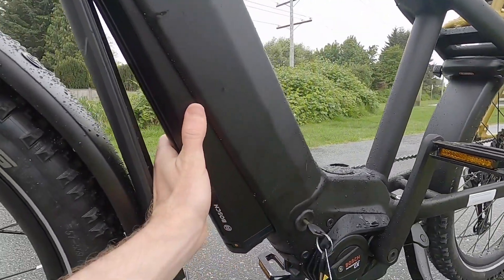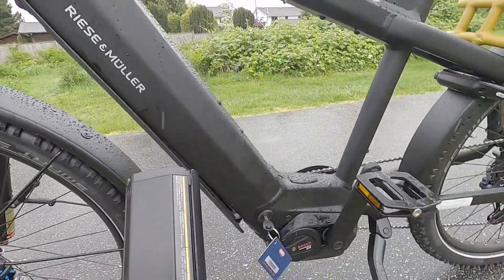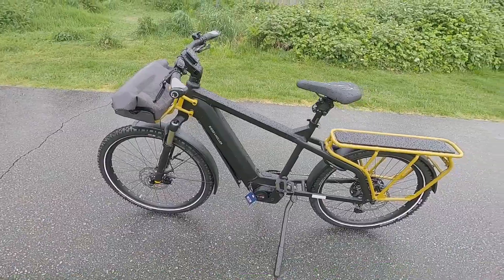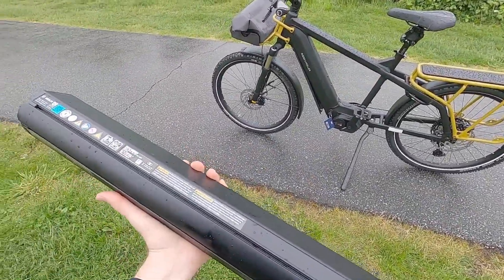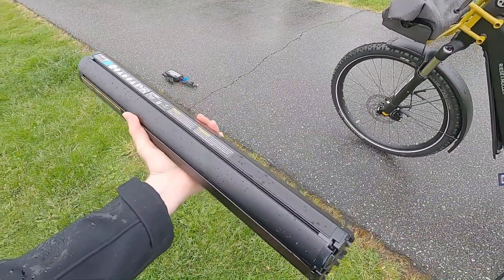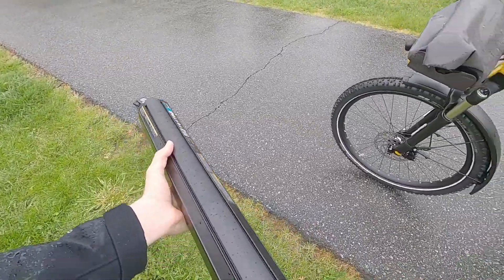This is like a nine-pound battery — pretty heavy, long, and big. You can take it off the bike, which is handy for charging or just making the bike lighter. The bike itself is about 70-plus pounds. You want to keep these batteries in a cool, dry location. Extreme heat is hard on them and they're not going to last for as many charge cycles. Extreme cold is going to cut your range in half, depending on how cold it is. So that's one of the trade-offs.